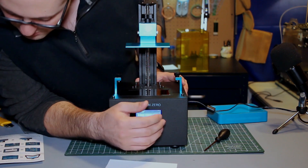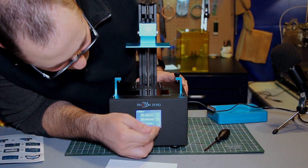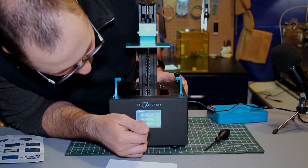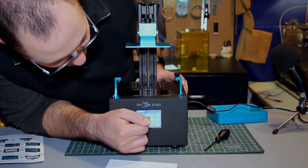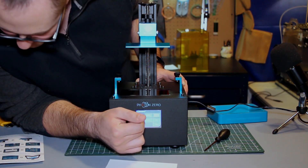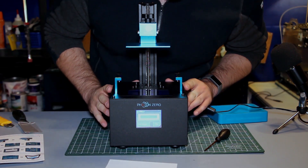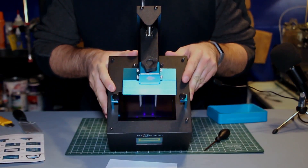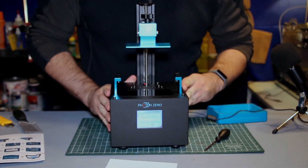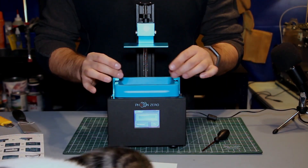We're going to finger press on top of the platform gently and then tighten the four screws to secure the platform. The build platform was ever so slightly crooked when it descended, but tightening the screws is aligning it much better. I'm going to return to Tools, set Z equal to zero, and now it will rise. It doesn't seem like the touch screen accepts input while the motor is moving. Let's display an image on the screen — we'll go to Detection and select a pattern. There we go — UV LEDs on and the LCD is showing a pattern.